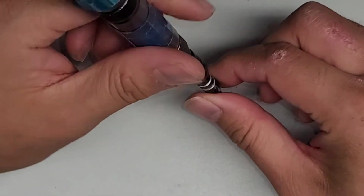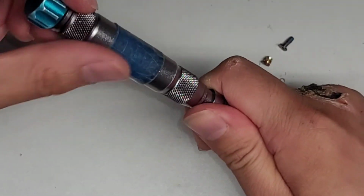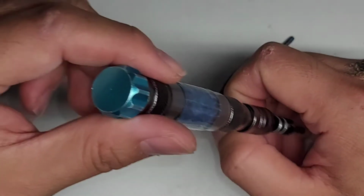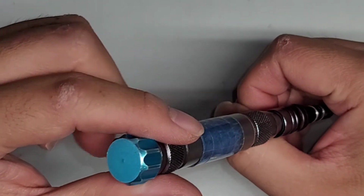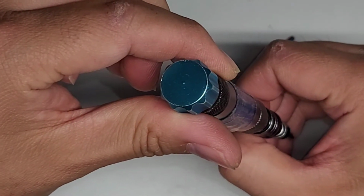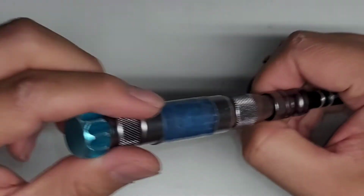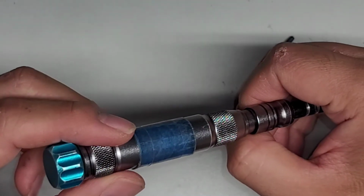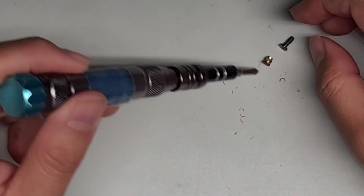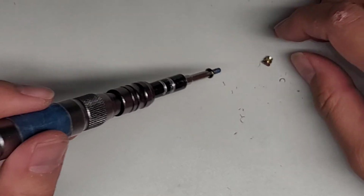So what happens when the screw comes loose, the hinge is no longer holding tightly like this. It's more open like that, and it's basically allowing the screw to do this. And on top of that, since it's not a smooth motion, you see how there's this gap here? So what happens is it suddenly pries it out. And that sudden motion is what causes the hinge to break. It's not really the hinge mechanism that breaks. It's very rare that the hinge itself will break.